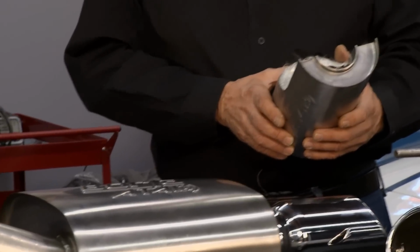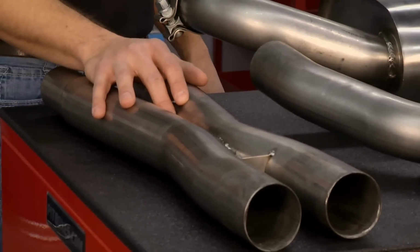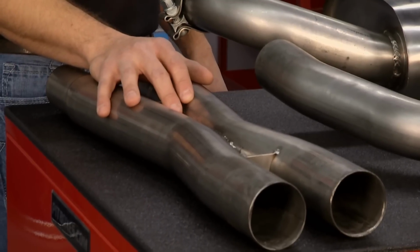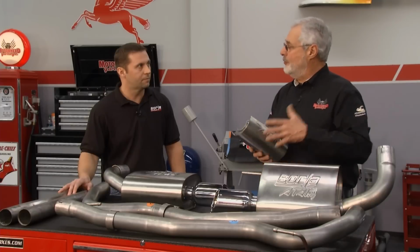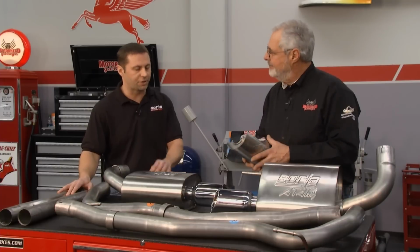And let me say something else about the flow, too. When you're getting rid of those 3 mufflers and you have this X-pipe, it's also going to help your flow instead of having that front muffler like on the OE system. So you really don't build more horsepower. You just release the horsepower that's trapped in the exhaust, bring it to the rear wheels. Exactly. Get rid of that restriction in the original equipment exhaust. That's great. Let me check on Davey.